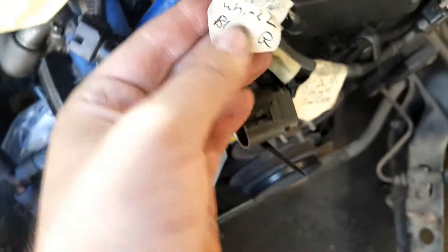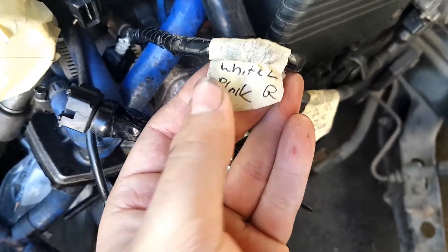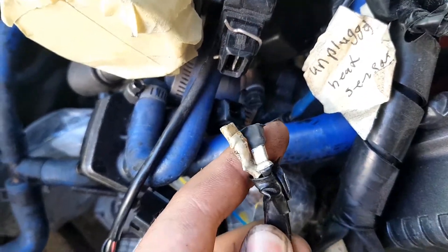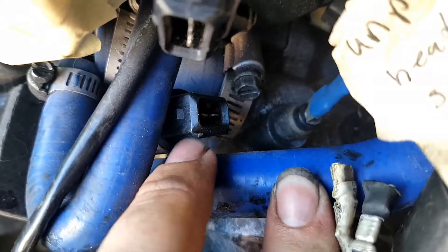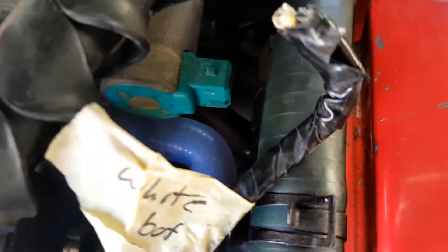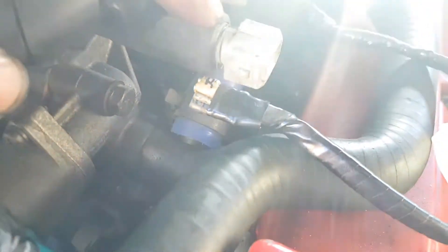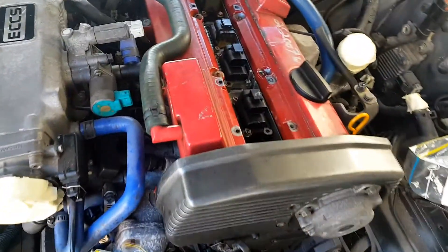Alright, just want to highlight one more thing on the wiring harness. White is left, black is right — right here. White is left, black is right. So there's another one of those cheeky things. We're doing white on the bottom, so that goes into that green plug, black facing to the sky. Another one of those plugs — white is right, so that goes into here, just like that, straight in there. So we got all the wiring harness disconnected.